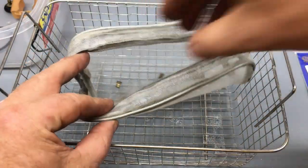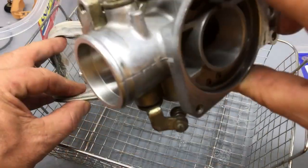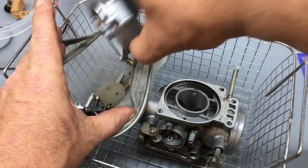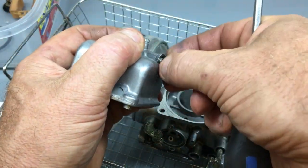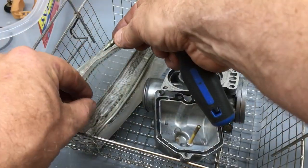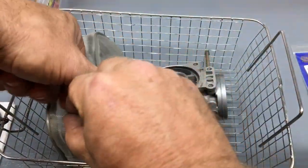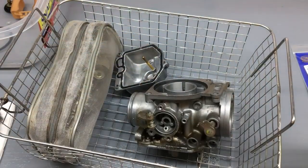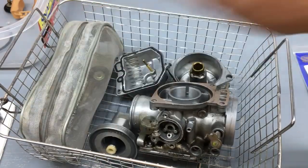All of the fine, small parts go into a sealable mesh bag, while the bigger stuff can sit in the cleaner's wire basket. I check and double check that every piece is accounted for. I really don't want to have to go searching should one of them go missing a little bit later. I'll soak them for 30 minutes in a mixture of Dawn dish soap and Pine Sol. That combination removes all the stains and won't discolor the aluminum like some other cleaners.